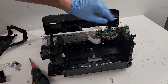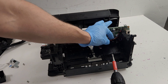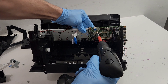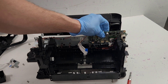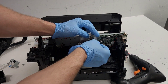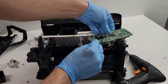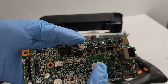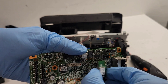That gives us better access to the main board. Let's see if we have more screws holding the board - just one screw right here. So basically three screws were holding this board. Keep in mind there are some connections on this side, so go ahead and remove those. Just one wire was connected right here on that side. Here is the wireless board right here, connected directly to the main board - just pull it out, there we go.